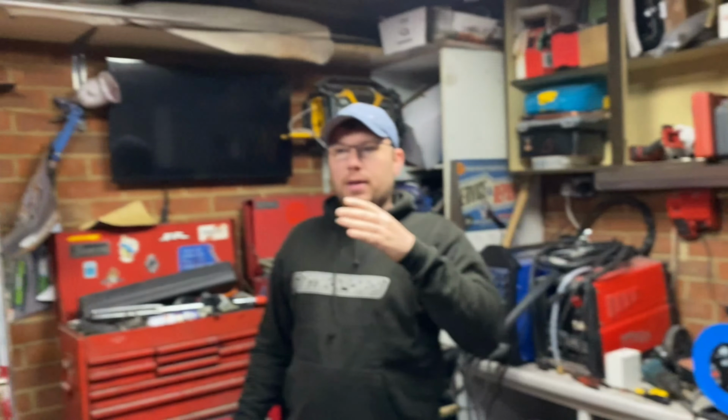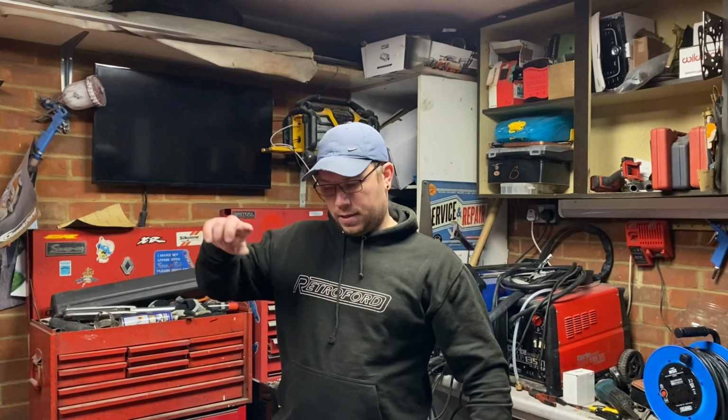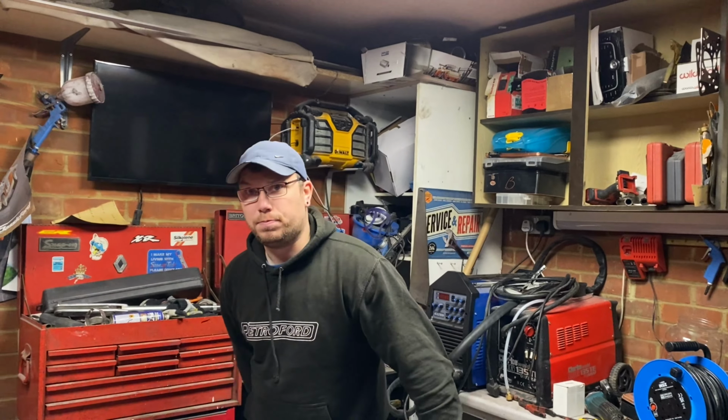I'm quite happy with this turbo. Beforehand it was quite lazy coming into boost. I think it was because it was so fat just as you get into that threshold. So just at that changeover, we took quite a lot out, and then put a little bit in at the top because it had a bit of a lean dip. There was a lean spot right at the top, and there was a lean spot just where everything's coming on. So just flatten that out, and that last pull seemed to be fine.